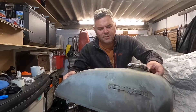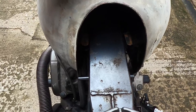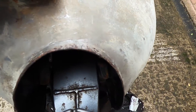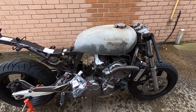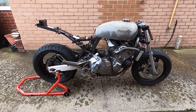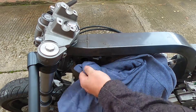I'll probably have to move the rubbers to a different position. Overall I think that's going to completely change the look of the bike. The tank does fit and the tunnel fits over, but the original tank mounts are catching and stopping the tank going into place. To get that sorted I'm going to have to cut off the original mounting points. The back is probably near where it should be but the front needs to come down a bit.